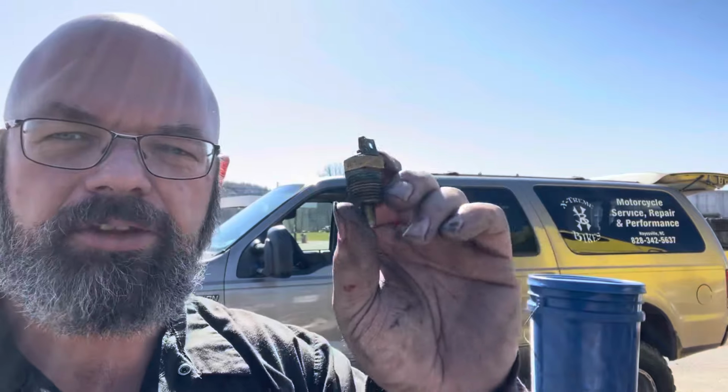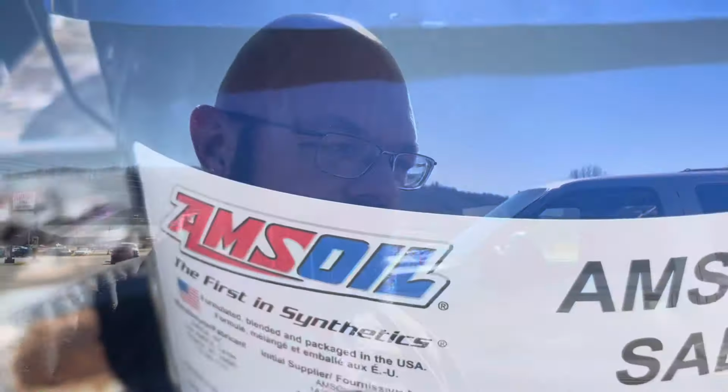I have to admit, my first thought was I didn't want to put the new temperature sensors in just yet. What I wanted to do was install it with the old temperature sensors, get everything painted, and then switch the sensors out, because then we'd have the nice pretty brass sensors in contrast to the fresh paint. But those actually sit so low in the oil sump that to change them out, we're going to lose a bunch of fluid. So I'm just going to go ahead and install the new ones now, and we'll do a fairly diligent job at taping those up when it comes time to actually do the paint job.